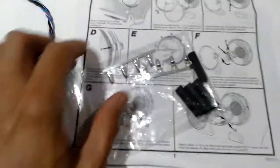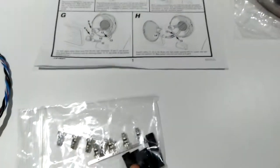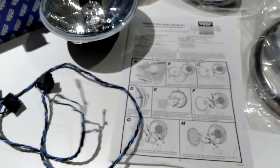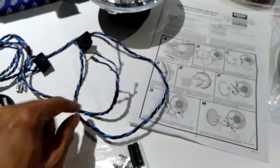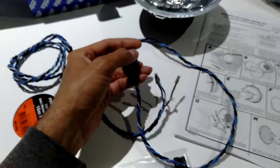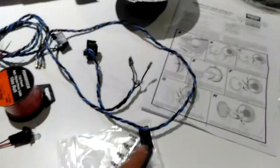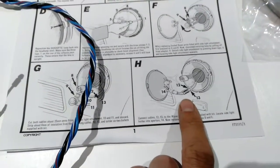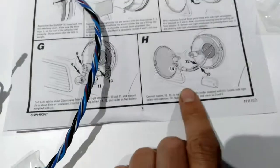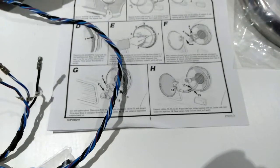The other useful thing it comes with too is these terminals. These fit a lot better into these than just the standard generic ones that you can purchase. So these are designed for the same fittings. All right. So first thing I need to get started then is, the way it will work, this red wire will come out here, have a connection on here, and come all the way back here. So the black cable on there, the earth pin from that, needs to have another wire coming back from that connecting up to here. So I will most likely use these terminals and just do it how it's shown in the diagram there, because then if I ever need to replace the park lights or the fittings, it's easier to do. So that's what we'll aim to do. All right, let's get started.